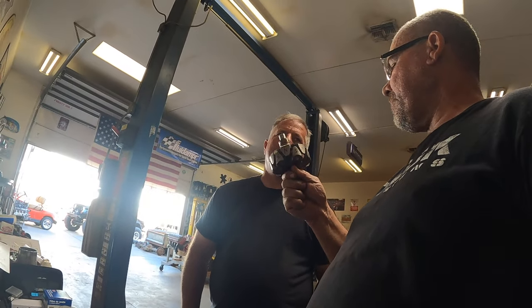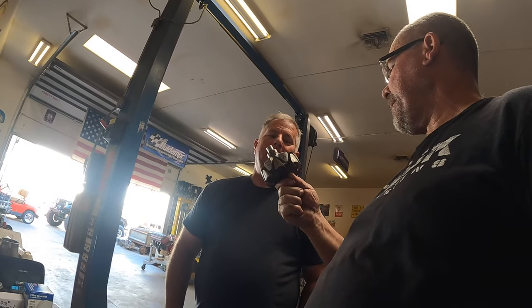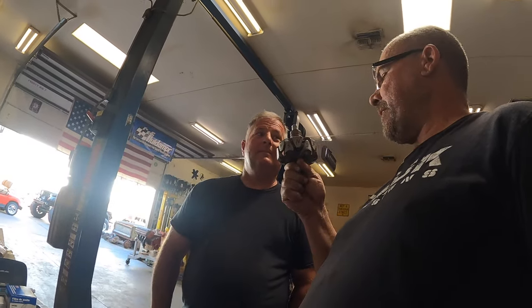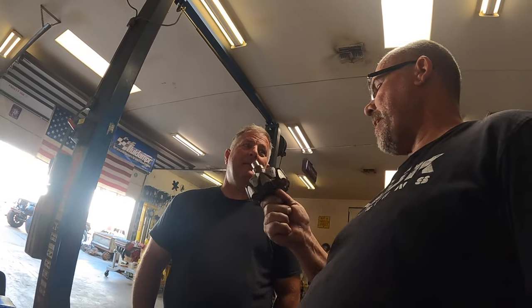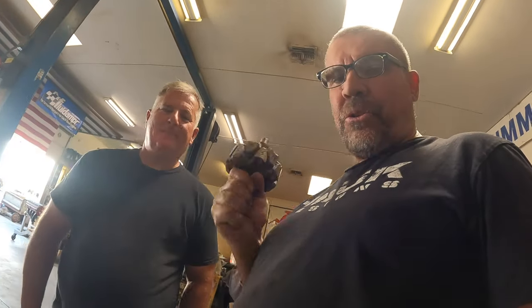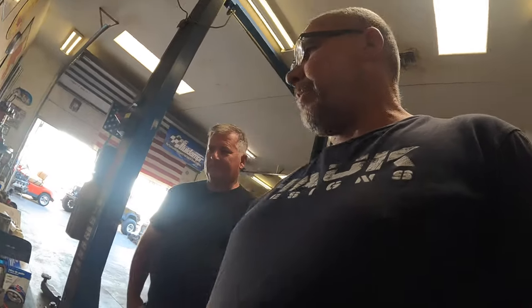The key to making our alternator a welder is being able to turn those magnets up as hot as possible. I've always thought about using some of the voltage from the other side of the alternator to run the field - I don't know how much they'll take, but at 24 volts this will weld at idle. But I think it is better for it to spin faster, so we'll stick with what we know works. One day I'm going to experiment with that and actually regulate my voltage going into this so I can control my temperature with a voltage regulator instead of throttle.